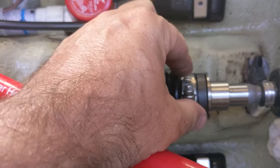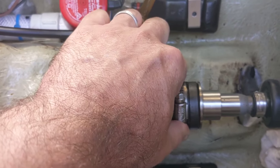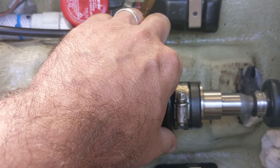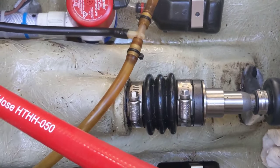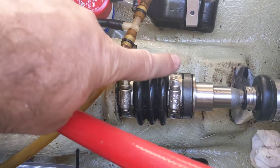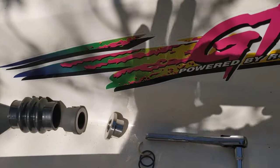You can actually move the carbon ring with your fingers — I can move it back and there's a gap. If we were sitting in water, water would start coming out of that hole. But it has just enough pressure to push up on this ring here, that slip ring, and that piece is stationary with the shaft. So it's always spinning; the carbon ring is not spinning, and the two surfaces slip together without any grease or anything.